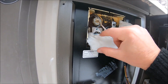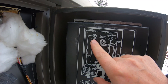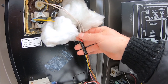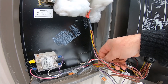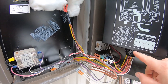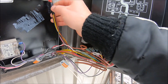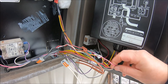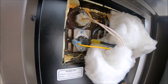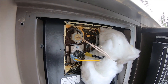Now we're showing 210 and it shows high because the water temperature is high, so it got too hot — it's no longer regulated, just burning in there. Anyway, when it shows low, the water level is possibly low. So you open this controller area up here, and according to this the one to the left here is the water level sensor, which should be right here. There may be an issue — there's a couple of butt connectors there, maybe the sensor itself is an issue, and then it goes into the control board.